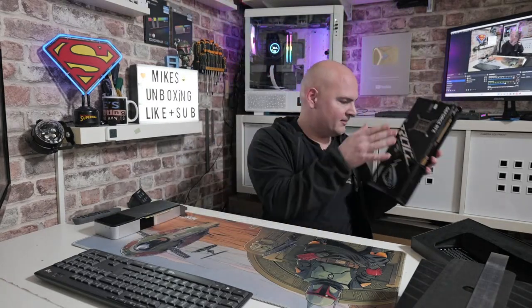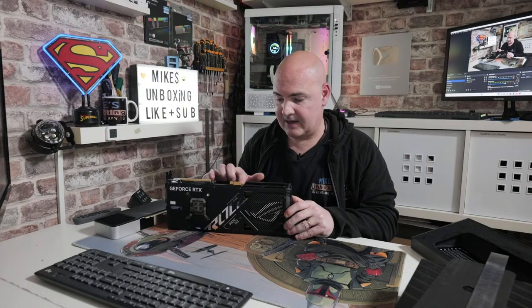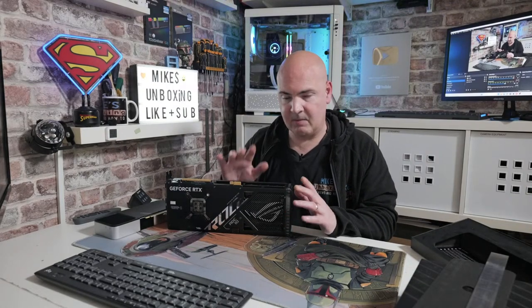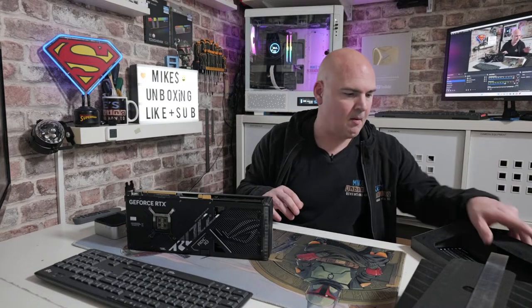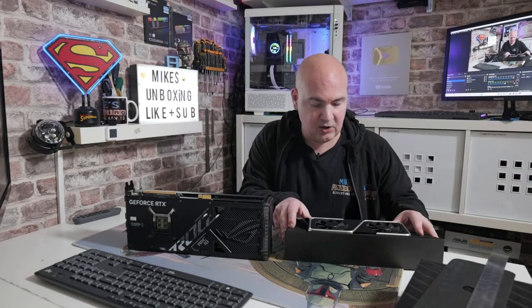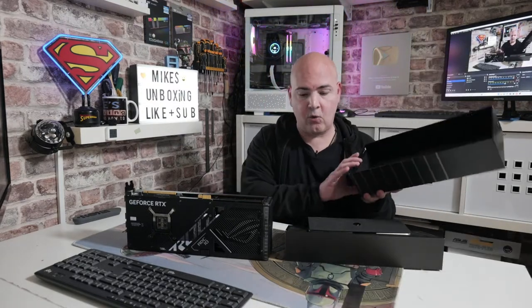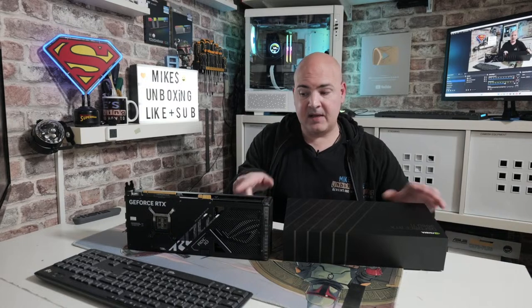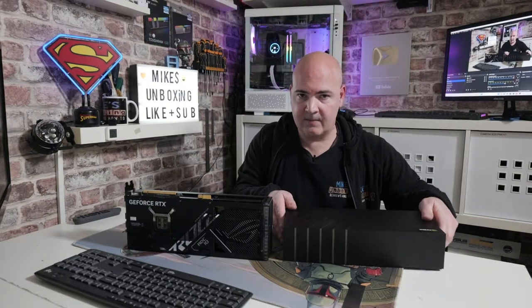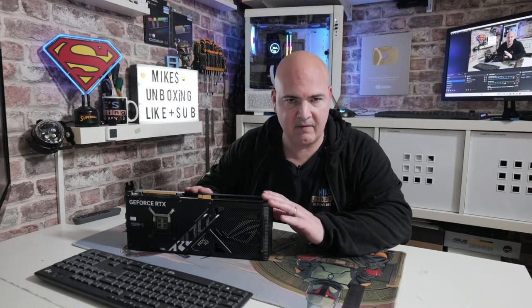So that is the graphics card. Riley says, interested in the extra gold fingers on the GPU. So the extra gold fingers are basically power. That's where the power comes from. So that is what is connected to the motherboard. If you're purchasing ASUS BTF stuff, anything from the BTF range, they all work together. If it's not in the BTF range, then you're going to have to plan ahead a little bit. So the BTF motherboard will take a BTF graphics card or a standard traditional graphics card. The BTF graphics card, on the other hand, will only, and I must stress this a lot, it will only ever work in a BTF format motherboard.